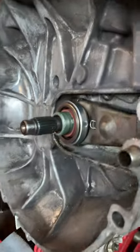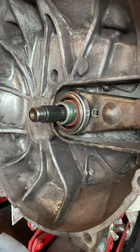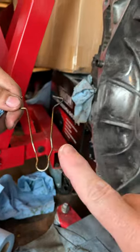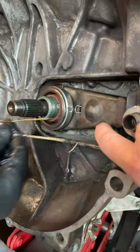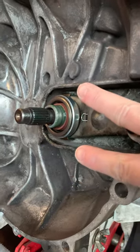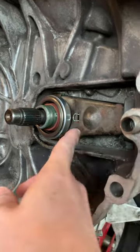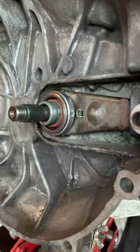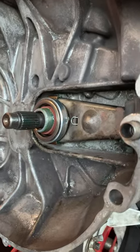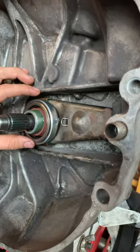The work he did caused some cable jam-ups up around the top of the transmission. One of the things we did notice when we took this apart is that the little spring clip that sets inside the little arm here — that part of the clip that allows it to snap onto a little ball stud that sticks out in this area — when we were messing around with the control arm, we just pushed it out and all of a sudden the whole arm just basically flopped off.